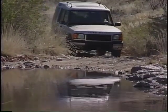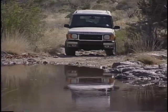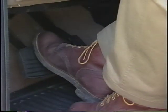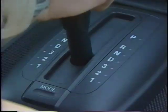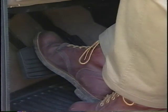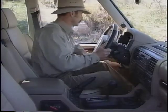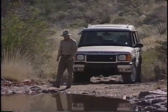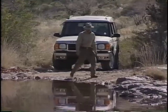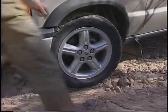Water crossings should be approached with caution. First, get out and check the conditions. Try to park on level terrain — always set the handbrake. Hold the vehicle with the footbrake, press the button, pull up and set the handbrake, shift to neutral, then release the footbrake slowly to assure the vehicle is holding on the handbrake. Then shift to park. For water crossings, consider the depth, distance, and current. Check for obstacles beneath the surface — is the bottom solid, rocky, or muddy? Make sure it is firm and clear of debris. Recommended wading depth is 20 inches, or about the top of the wheel rim.